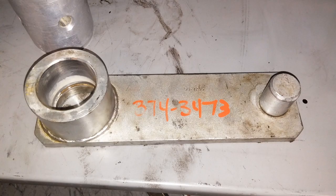What you'll need is a 14 thousandths and a 24 thousandths feeler gauge. These are not special feeler gauges — I've just cut them. You're going to have to cut a small portion off because the full width of a feeler gauge isn't going to fit between the cam gear and the idler gear.